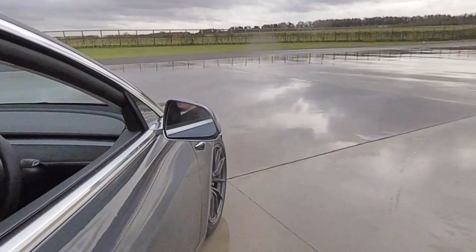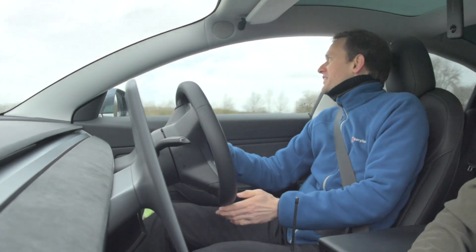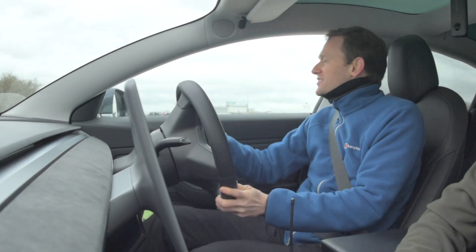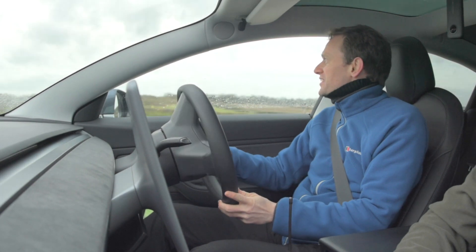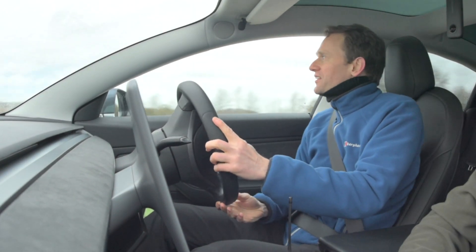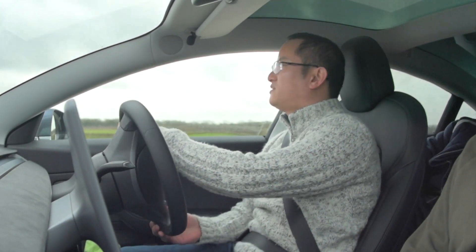Just the fact that the temperature has dropped to under 10 degrees centigrade means that summer tyres — the sort of tyres fitted to these cars from the factory — just don't work very well. A winter tyre or an all season tyre uses a different compound of rubber, and the design of the tread is optimised for wintry conditions, giving you a lot more traction and grip even in the dry when the temperature is cold. But in wet conditions and freezing temperatures, the difference is even more clear.